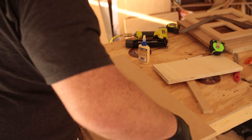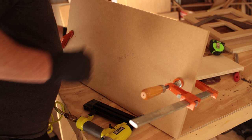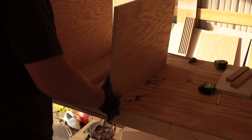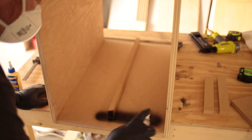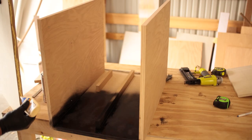I'm using brad nails — inch and a half — and I scribed a line along the bottom to place the nails. For the plywood I'm using wood glue on the bottom, and because it was warped I'm using clamps and a spare piece of wood to tap it back and forth as a guide. I brad nailed the bottom together as well. Here I'm pre-painting the bottom part of the port — in hindsight I probably shouldn't have put paint where glue would go, but I haven't had any rattles since.